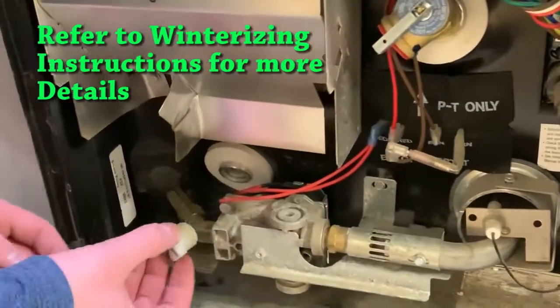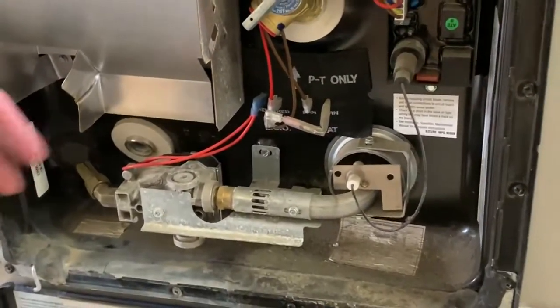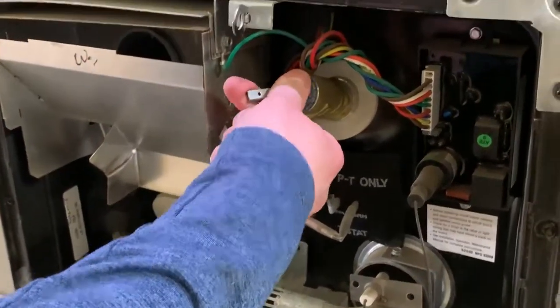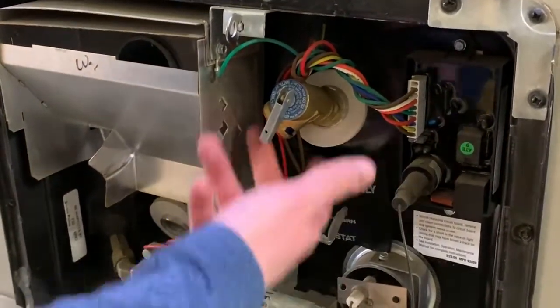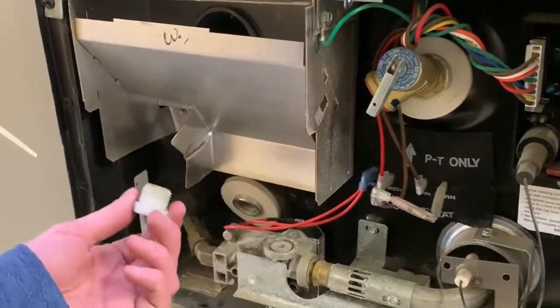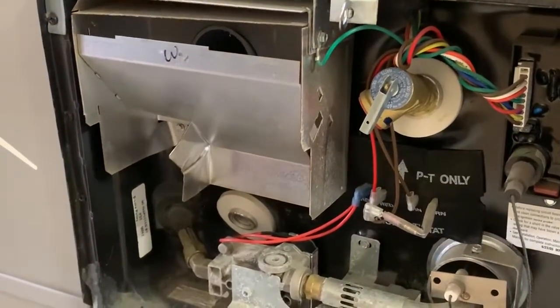This is usually going to be plugged so it allows it to become hot and build up pressure. If you do want to relieve the water out of this system, you can pull this tab right here and it'll relieve the pressure and leak out. That way, when you're pulling this cap off, it'll easily flow out instead of it being pressurized with a bit of heat as well.